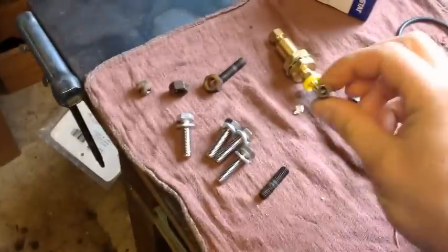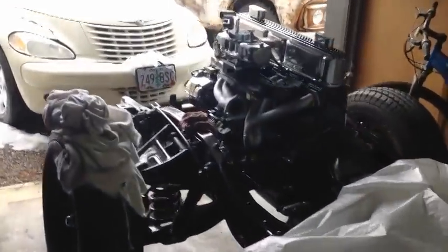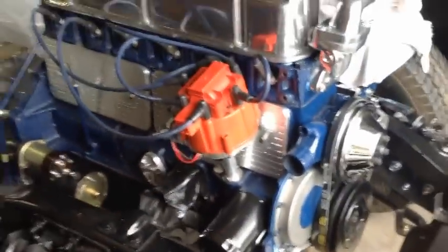These are the bolts here, and then these are the valve cover bolts — or allen screws more or less. I think they kind of look cooler, and that valve cover was actually made to use allen screws. This Friday we should be getting parts in, so hopefully Saturday we'll have another update on the motor. My distributor should be coming in, so I'm going to be taking those plug wires and cutting them to size, then get the distributor in. I'm not going to time it perfectly because I'm going to have to pull it back out to prime the motor when that time comes. All righty guys, see ya.